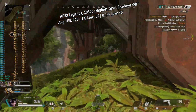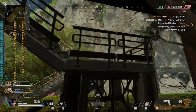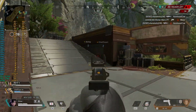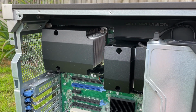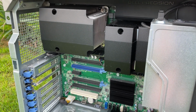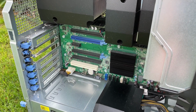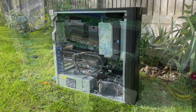I think the old Xeon E5s are still somewhat capable even from a single CPU perspective. Considering the age, it's impressive what one of these can still do. I wouldn't necessarily recommend an old dual Xeon build, but socket 2011 boards are getting cheaper by the day, and considering that these CPUs don't cost much either, it may be a route that you might want to at least consider if you want something for light gaming and editing. Personally, I'd just put together a cheap 8th gen i5 or 1st gen Ryzen build instead, but that's the boring approach of course.